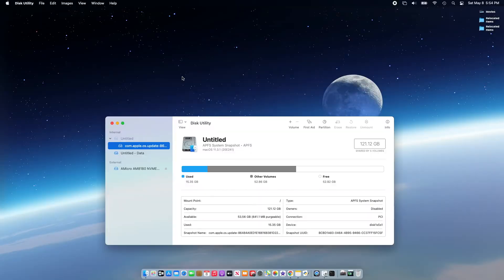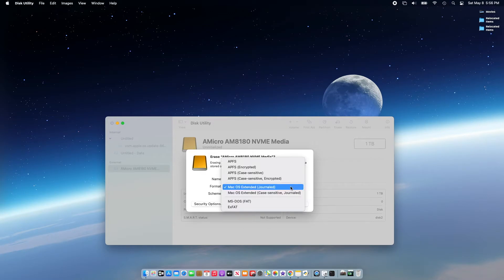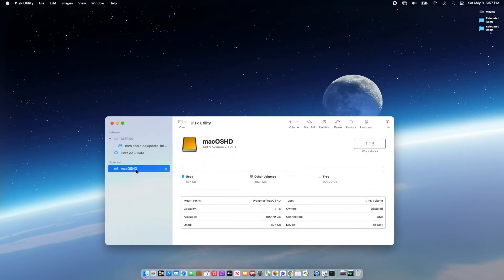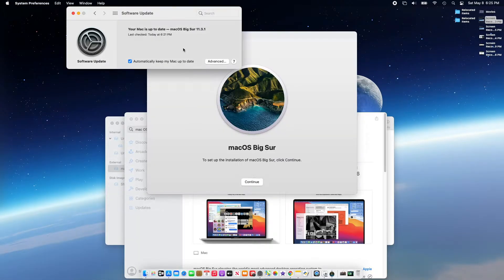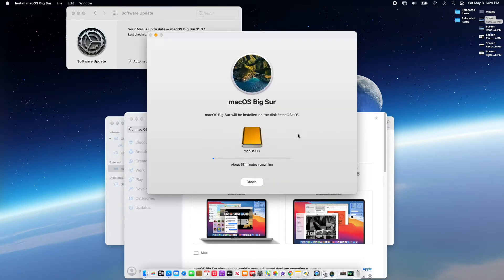The moment that the drive pops up, just hit ignore and open it via Disk Utility. Click Erase to format it and then assign APFS as your volume type. Then go ahead and start installing the current operating system — make sure you have an updated version. Once confirmed, install the operating system onto your external drive by following the instructions on screen.